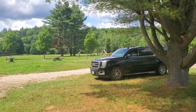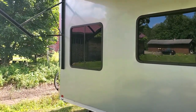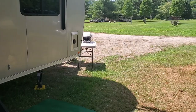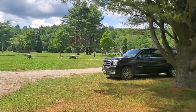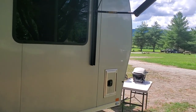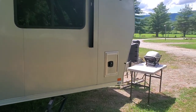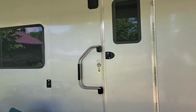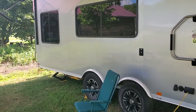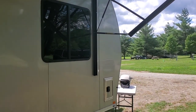In summary, I've been pulling this trailer with a Yukon — a 1,500-rated vehicle — and I'm within the tow specs weight-wise. It has no problem pulling it. This thing is actually very light and pulls very straight. The only thing is the stability with the Yukon — it's a soft suspension, so you don't get great stability when there's a lot of wind. There are also some issues with tongue weight, and the load levelers built into the truck have to be able to handle that. I'm probably going to upgrade to a 250. If I had to rate this trailer overall, I'd give it a 9. There are a few things, like the back door, but it's very well built and very sturdy.